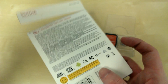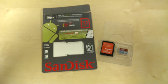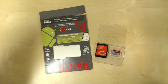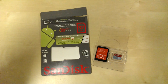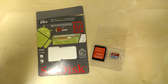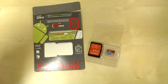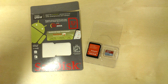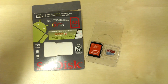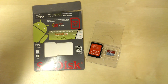What surprised me in general is that this is a very high quality copy. If I wasn't such a geek, I wouldn't have noticed at all — I would have just plugged it into my computer, and about a month later when I filled it up, I would have started noticing it was failing. The instant thought would have been that SanDisk isn't as good as it used to be. You can tell that from some of the Amazon reviews — all of the one-star reviews are slating SanDisk, saying their quality has gone down and it failed at around 8GB, 5GB, or even 2GB on worst occasions. I'm near enough 100% positive that in all those cases, they've unwittingly bought a fake card.